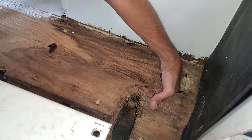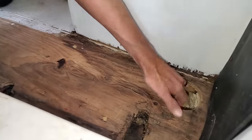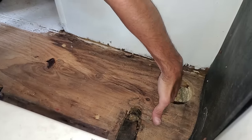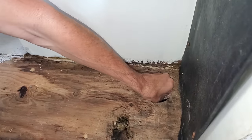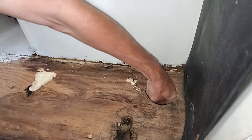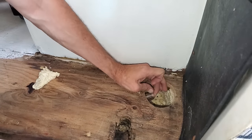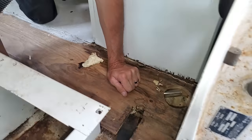This is 1 inch inner diameter tubing. The outer diameter is 1 1/4. So in theory, we can take the 1 1/4 inch grommet, add it to our black tank, run this in at the very top, as high as we can get on the black tank, and have our gray drained to the black. Oh, dope. Which is nice.